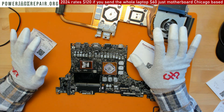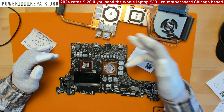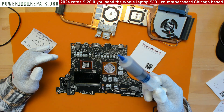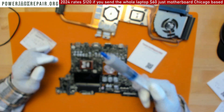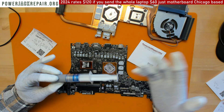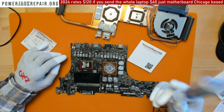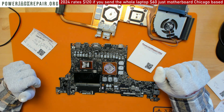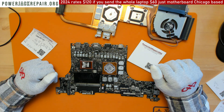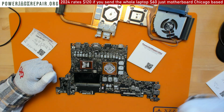Try to do it carefully so that all the liquid metal stays on the CPU and GPU. When I reassemble it, I'm just going to put a regular thermal paste — something simple, silicone-based — because I'm sure both the CPU and GPU will last much longer with a simple paste. Thanks so much for watching, please like and subscribe. The repair rates for replacing these connectors are listed here.